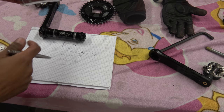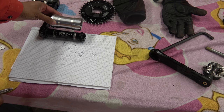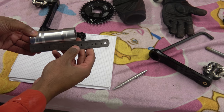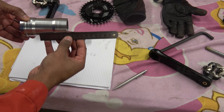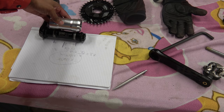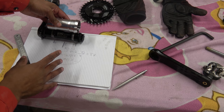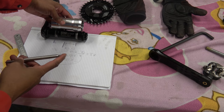The center of this custom bottom bracket — because it's much wider — needs to be at 37 mil, so almost where the T is on 'boost'. This is nominally 95 mil, so about 47.5 is the center. If you bring that over, it lines up with the T. That's where we're going to be running. With this, ideally you want the bearings as wide as possible, but you have to draw a line somewhere because you may make it incompatible with a large number of cranks. So I've got that set there — that's where we're going to run.